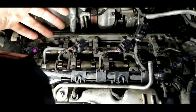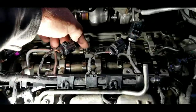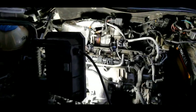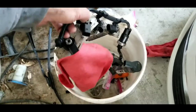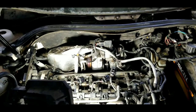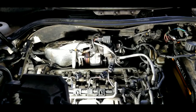It's really not that bad. It seems like a big deal because it has the injectors going through here. When you take off the nuts for the injectors and take off the injectors, leave them all together like this - I've got them all still in order. The reason I keep them in order is because if you don't put them back in order you're going to have to reprogram the injectors through the computer.